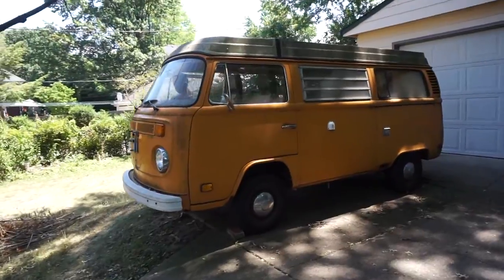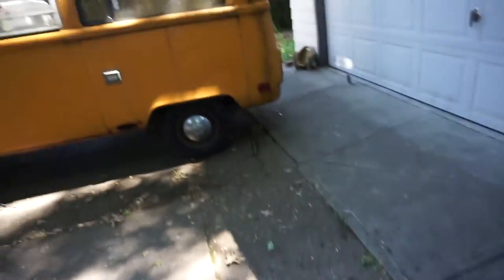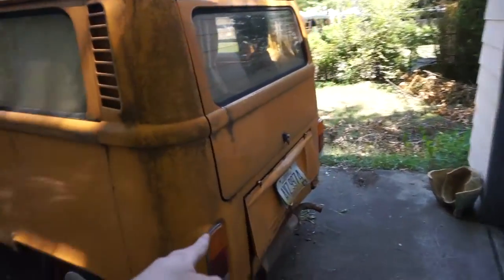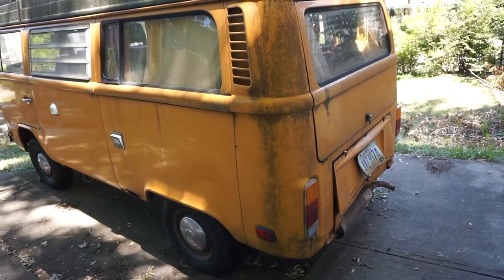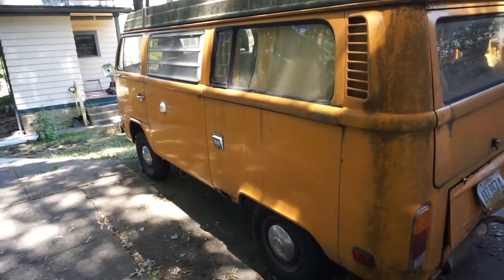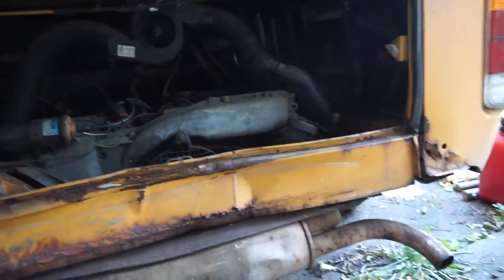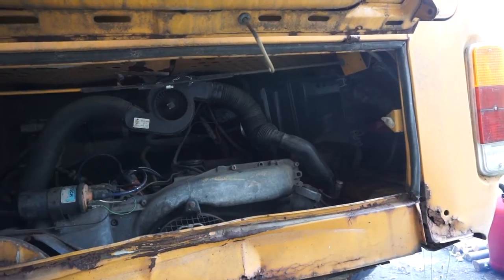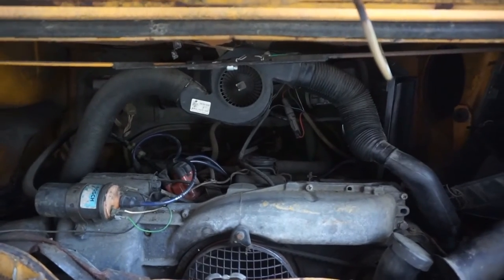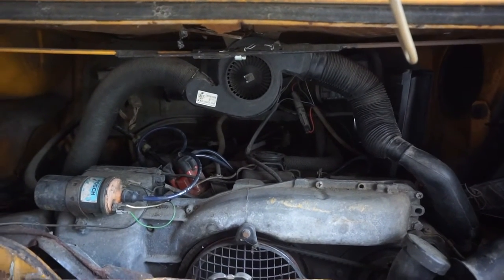Today is a new day. We're back — there's my friend Hunter. The Volvo 240, as you can see by where I'm standing, is gone. I brought some gas and I also filled the tank with gas yesterday. Now with a charged battery, we're actually going to see if this thing will start. I really hope it does because I don't have a car trailer to take this home. Basically what I figured out is when you turn the key on, the relay for the fuel pump clicks, but there is no fuel pressure — and I can only assume the fuel pump has gone bad. So I'm going to order a new one off the internet and we'll put it in, I guess, in the next episode.